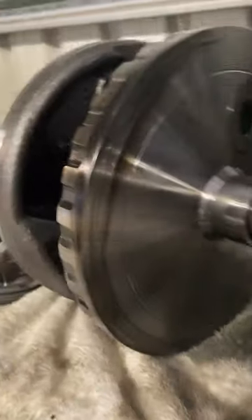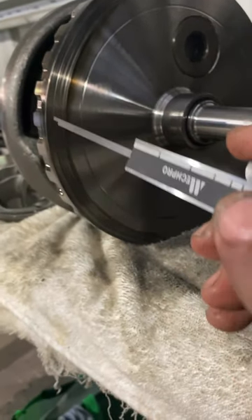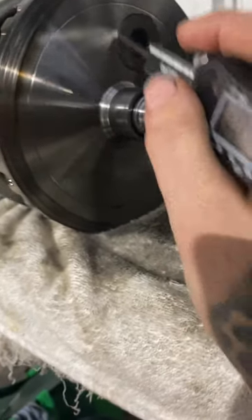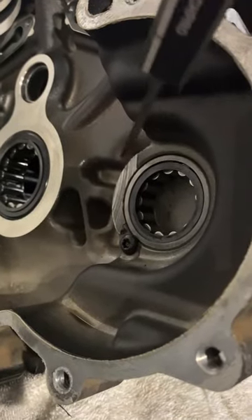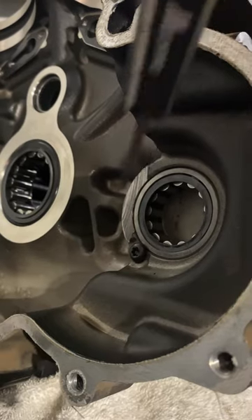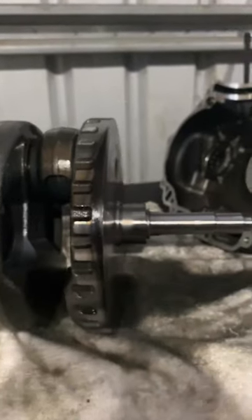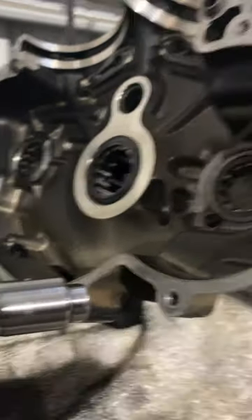On this side we've got 180 degrees of wear on the flywheel — very abrasive, very rough. Our pin here is looking relatively okay; however there's obviously been walk in it. Where our balance shafts go, there's quite a lip there. We've seen wear from the force of this crank separating — it's got no end float, so all it can do is meet and bind with whatever it touches and destroy everything here.